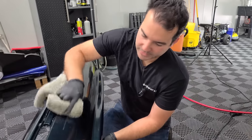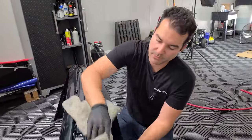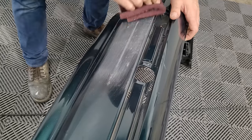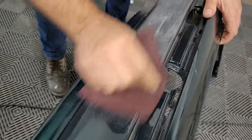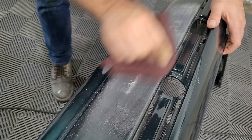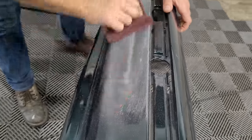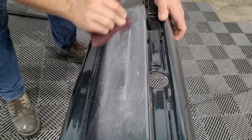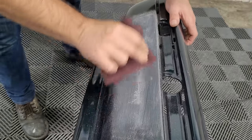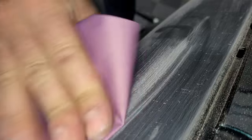The good news with this bumper is that we have extra Oxford Green paint and clear, so this gives me an opportunity to show you a spot repair on a bumper — a really common repair procedure. We're going to scuff this area up with an aggressive Scotch-Brite pad. The rest of the bumper isn't absolutely perfect, but we're not going down the rabbit hole of painting everything because we're on a super crazy low budget. This is Legit Flip — we're here to make money.